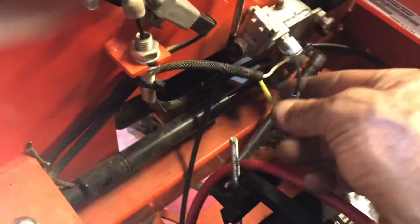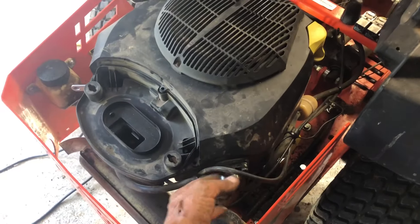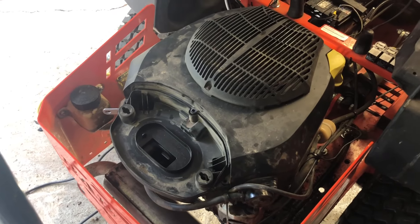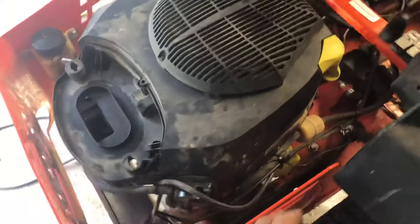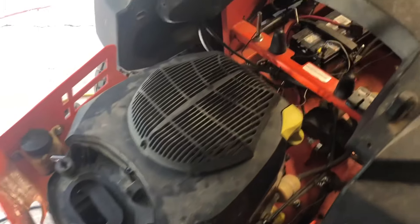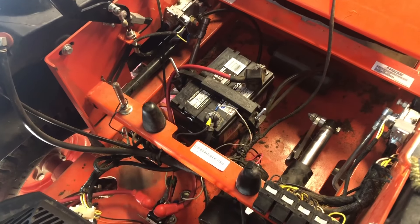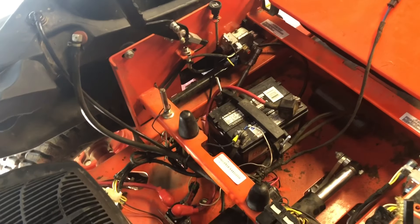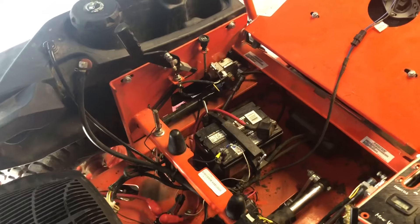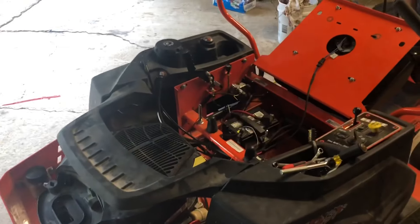This voltage regulator I replaced - I think the main thing was this switch wire was broken for the safety switch. Changed the coils - one side was eaten up by mice, you'll see a video of that. Got the air cleaner, air filter, oil filter, and oil. Just basic overall maintenance, but really pleased to finally get this thing going. Thanks to those at Stone's Farm Implements - he led me in the right direction, made me feel more confident I was heading the right way, and gave me a couple other suggestions to try. Hopefully next time you see us we'll be out on the yard mowing grass.